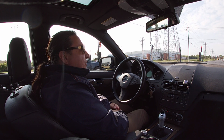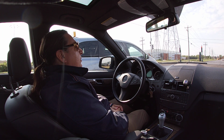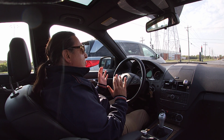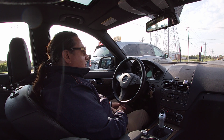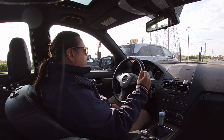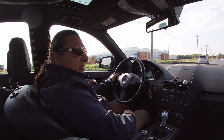Oh yes, another thing I like to mention is downshifting. Downshift is actually fun because you're doing what's called engine braking. So you're braking using the engine's compression to slow down the car. You can use a little bit of that and the brakes at the same time, and vice versa, and you can play around with that kind of driving style. So yeah, downshifting helps a lot in slowing down the car. Unlike automatics, I guess you can in a way downshift in automatic. Not the same as driving manual, that's for sure.